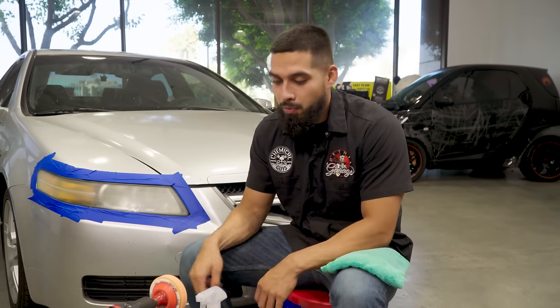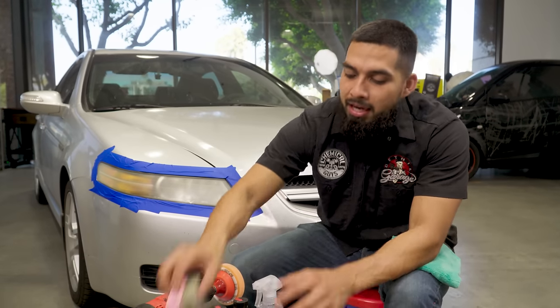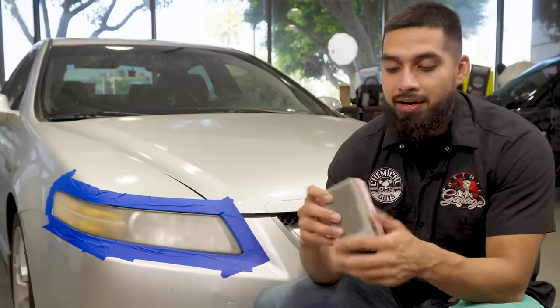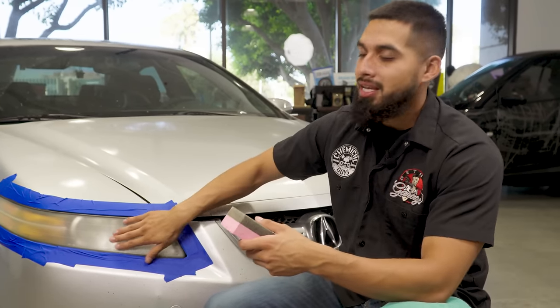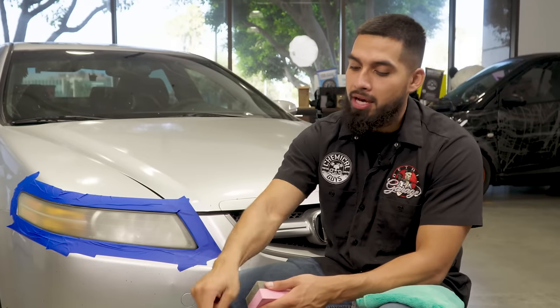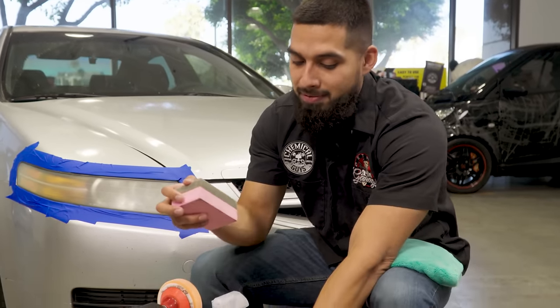So what do you actually have to do? It's fairly simple. We'll put the applicator off to the side and get our pink sanding block. This pink sanding block has a hard edge at the back that lets you get into the nooks and crannies, while the front is foamy and contours to the area you're working with. We're actually going to be wet sanding these headlights, because they're far gone and you'll get a better result with wet sanding. If you have newer headlights with just a very light film, you could go straight into a headlight restorer. But today we'll be doing two different types of wet sanding methods.